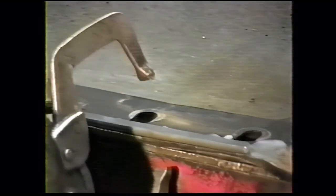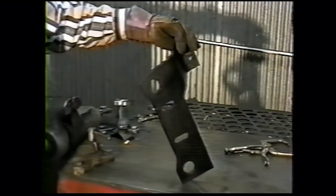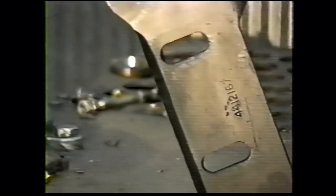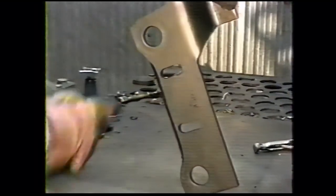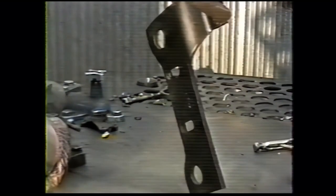Put it in place like so. Clamp it with a suitable clamp, and then weld. Welded, and it's painted. The plate we welded on is right here. We've done the weld, so it just blends right in. And that will give strength to the front of this plate that we removed by putting the bevel on. We've cleaned out the holes of crusted rubber, knocked the rust off. The new bushings will fit right on there without interference. This is now ready to install.